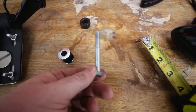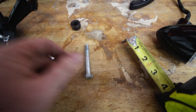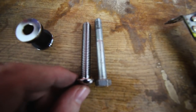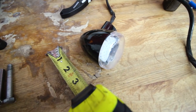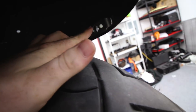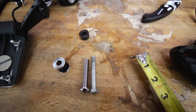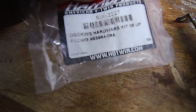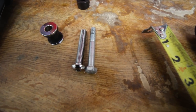I've got a plan of attack. Here's the stock bolt that we're going to have to use - the reason we can't use the bolt the kit came with is that not only are they two different sizes, but they're the same length, which won't work since we're going into the turn signals on the bike. Also the part under the fender is not threaded on the back like it is on the front. This kit is actually not compatible with a Street Bob like it said - it says FXD WD/DWG which is a wide-glide that has the turn signal on the actual fender itself.